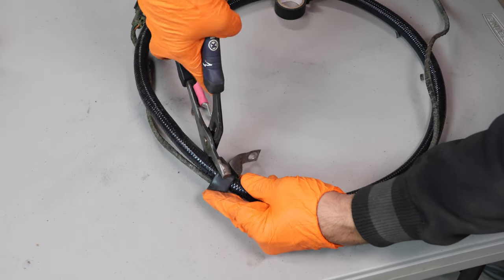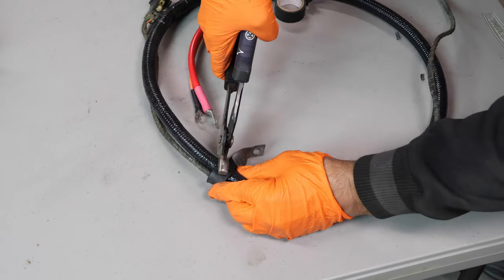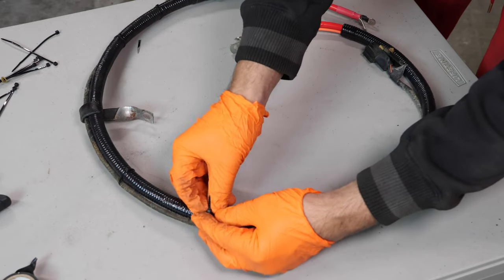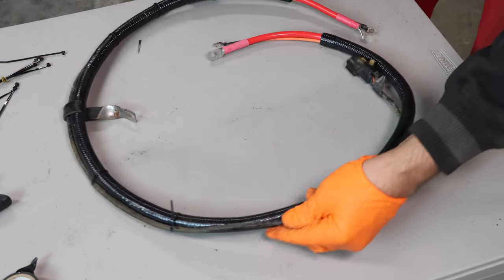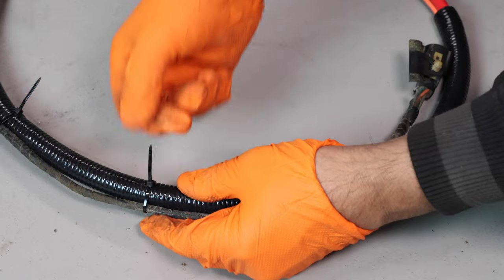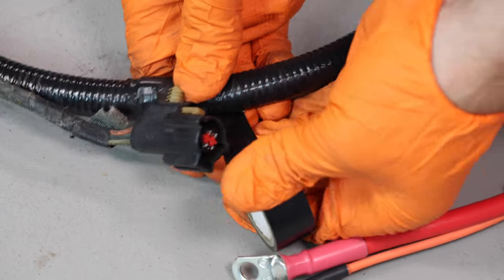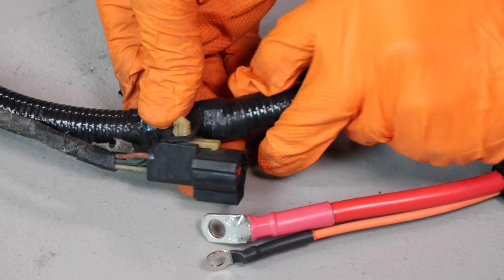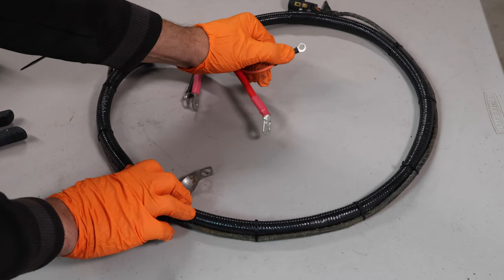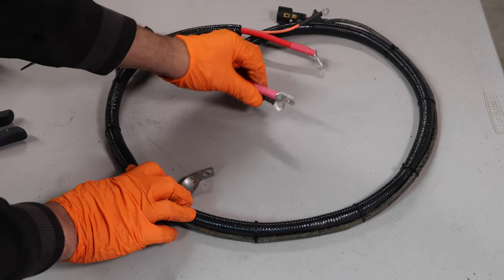Match up where the clamp went and clamp it down. I don't have any wire loom to secure the two wires together, so I'm just going to use a couple of zip ties. Tape the last end here and our cable is all ready. One thing to note: the smaller eye goes to the starter side, and the bigger eye is what goes to the starter relay, so make sure to pay attention to that detail.